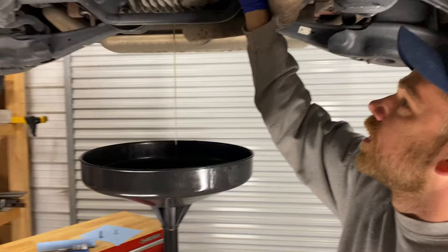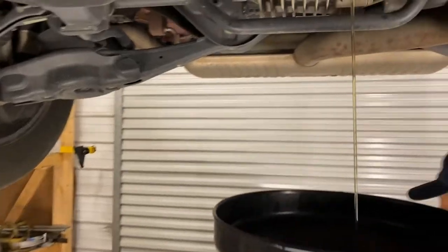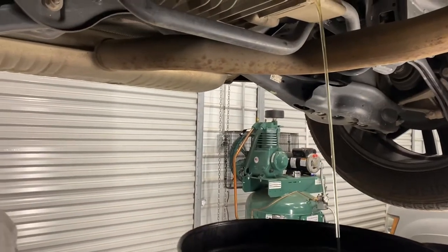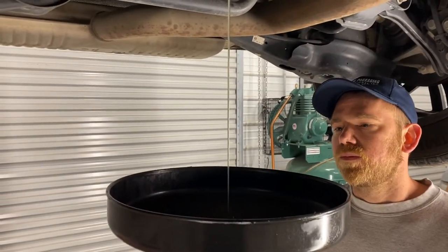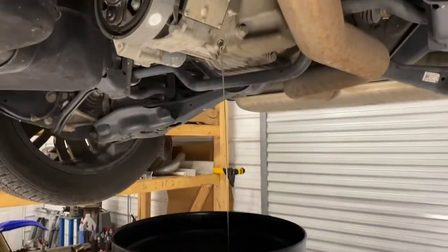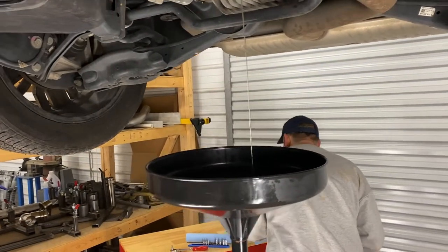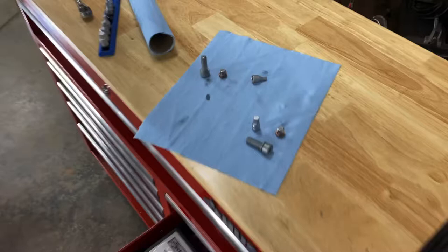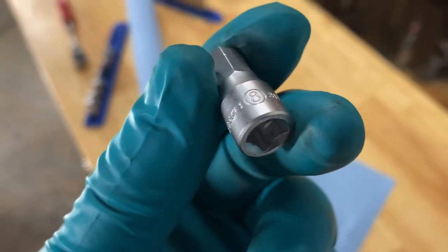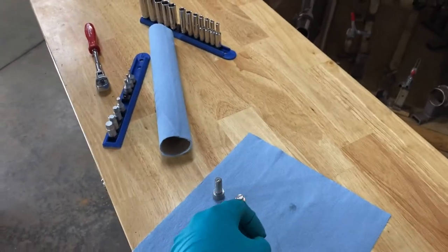Better than jack stands? Yeah, better than jack stands exactly. For all you guys watching this debating on DIYing this - you don't need a lift. The lift is just way more convenient and comfortable, but you'll get your crunches in if you do this on the floor. Just so people know: it's an 8mm for the drain and a 5mm for the fill. Rick's got a 10mm on the serviceable filter.